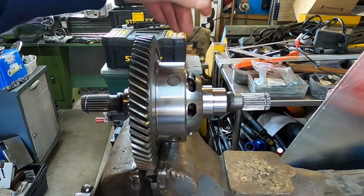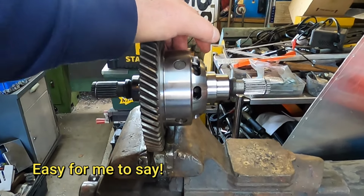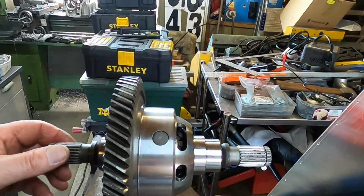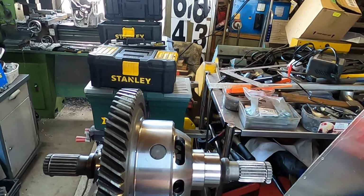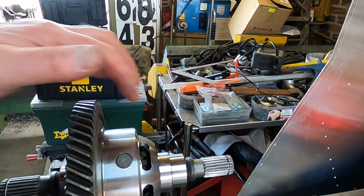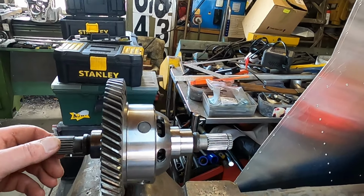Yes, I'm impressed with the Mini Spares version. Their molybdenum. I can't even say molybdenum. Anyway. They're very good. Go together very well. And they always rotate. Unlike another well-known version. As I was saying, I needed to use selective thrust washers on the other one to get it to rotate freely. It would just lock up if you put standard thrusts in.